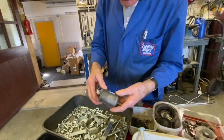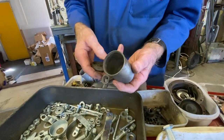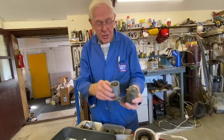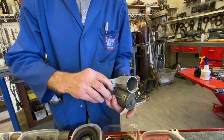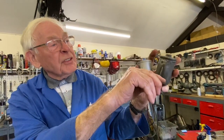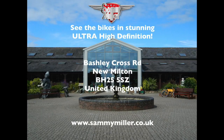This was the old float bowl here, as you can see — had a hard life, beat up, the top's all beat up, a bit of corrosion there, almost gone through — so we'll supersede that. But when you're finding those at jumbles and stuff, you've got to be super careful that you get the right one because there are a multitude of angles. That's a 70 degree one, so that's quite handy, but make sure that if you're replacing it you get them right — because if you've got the old float bowl cocked on the side, you ain't going to do any good. You're in the workshop now — just another day in paradise. You wouldn't exchange it for anything.